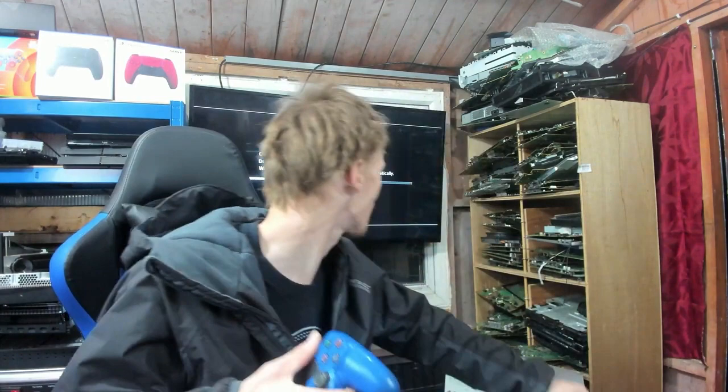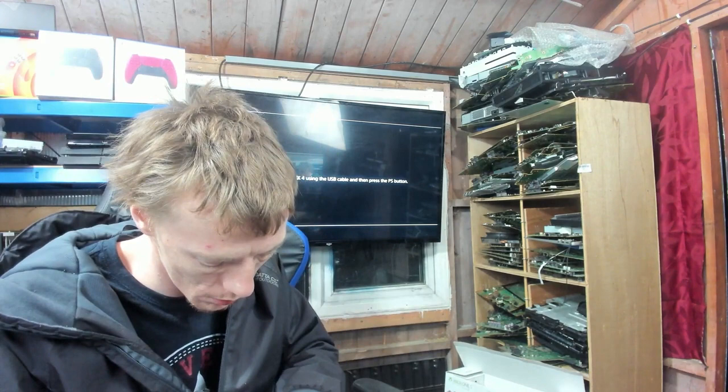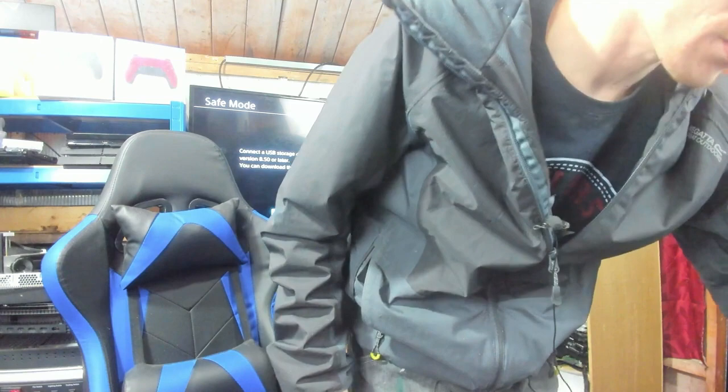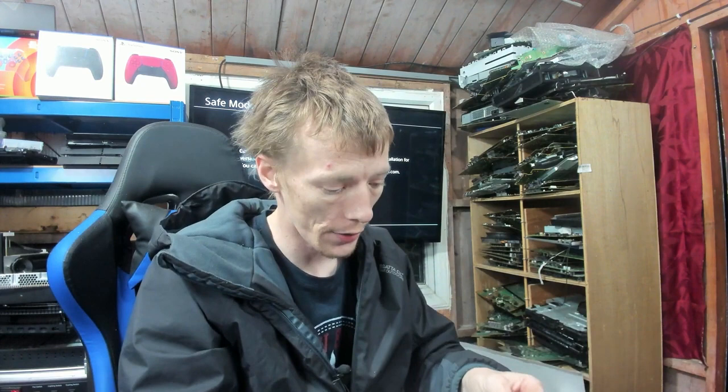All right, so I've got a controller at the ready. Cannot start the PS4. So it wants a system update file. So that's probably why it got sent in. So what I'll do, I'll download the software onto here, and then I'll reinstall the system software and take it from there. Alright, here we go.